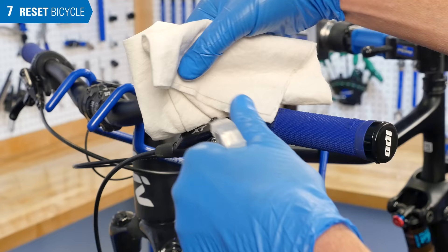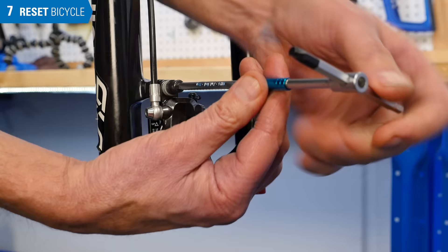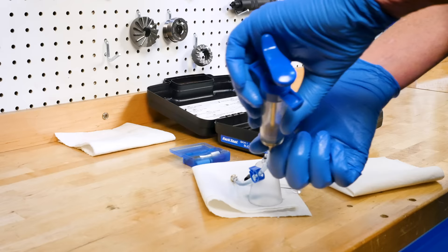Remove the brake block and clean the lever and caliper with a rag and alcohol. If removed, reinstall the brake caliper. Install the brake pads and install the wheel. Now pull the lever repeatedly to bring the pads to the rotor. Re-center the brakes as necessary.